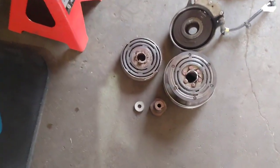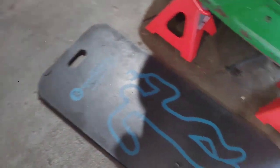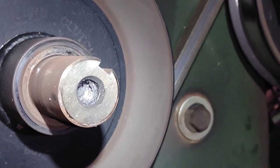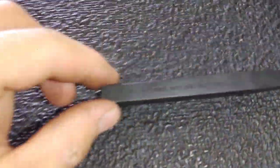Do me a favor, hit that like button, hit the subscribe button — this is going to be a quick short video showing you an example of that. So this Z915 came in with a broken clutch, as you can see there, and here's the broken bolt — the retainer bolt that goes up into the crankshaft. The rest of the bolt is still up in the crankshaft, broken off pretty rough and gnarly in there, looking like quite a mess, so we're going to have to extract that bolt.